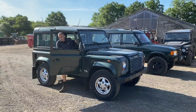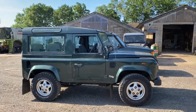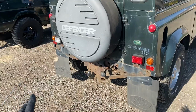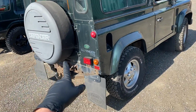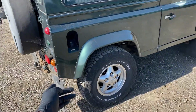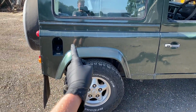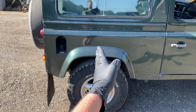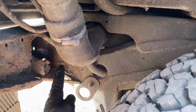Looking clean. The plan of action is going to be to take off the mud flaps, take off the rear wheel, take out the fuel tank, wheels and tyres, the fuel line pipes, pretty much get everything out the way, A-frame up and out the way, probably change the ball joint. And I know the rust is only limited literally just to the cross member.